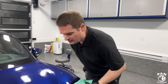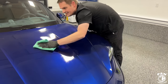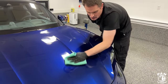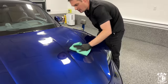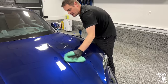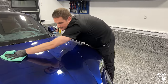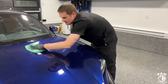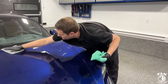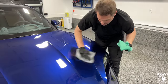Time to level the coating. Working at 20 degrees Celsius or 68 degrees Fahrenheit — always work on a cool surface in the shade. The surface must be cool to the touch; that is crucial. Do not work on baking hot paint and never in direct sunlight. You can do this outside, just make sure you're in the shade — very early morning or very late afternoon to avoid noontime sun. Use shorter nap microfiber towels when leveling coatings; they seem to work better for that task.